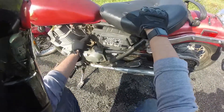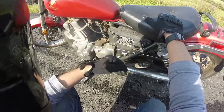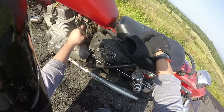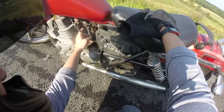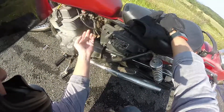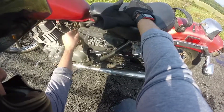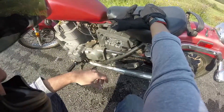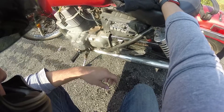We're looking at a little bit of a gas leak possibly coming out of the carb. The whole carb seems to be a little damp right now. I wonder if that's condensation — it feels cold and wet. Might just be some condensation built up. But looking at this tube, it looks pretty damp around the end, so we're thinking maybe there's a little bit of a gas leak. I thought if I got it out running a bit it might show itself, but I'm not seeing any drips yet.